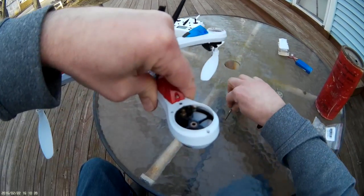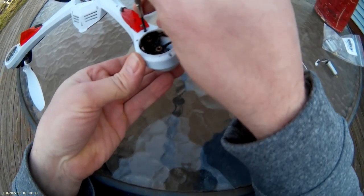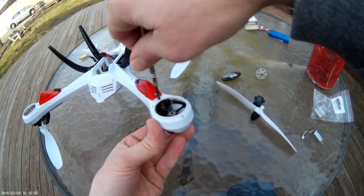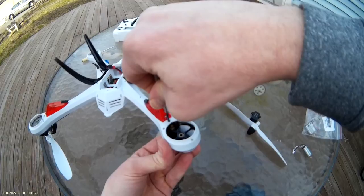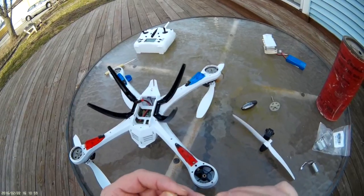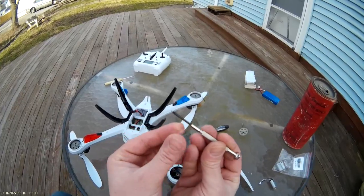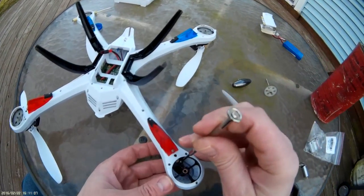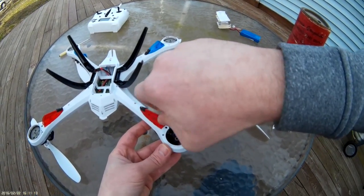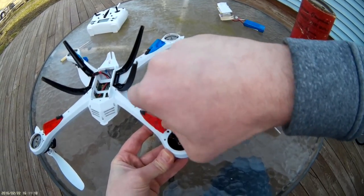Slide your motor back up in there and make sure it's all the way up against there. Since my screw is still sitting inside there, this is going to be easy — I won't even have to reach through. Just make sure I line up my screwdriver to the screw inside there and screw it back down. Get that one screwed down, then find your other tiny little screw. It's going to be hard to hold on to, so just set it on the end of your screwdriver. As long as you have it slightly magnetized it won't come off. Then screw that one back into its place.